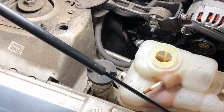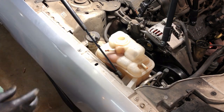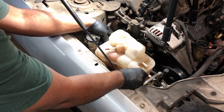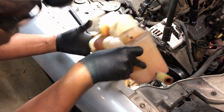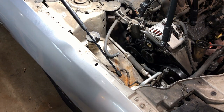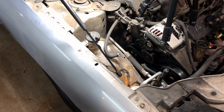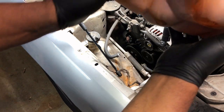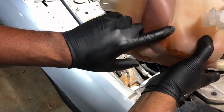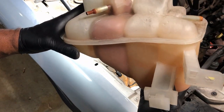We've got our washer off. We've got all our fasteners removed. Now I think we can simply pull up on this coolant reservoir. We've got everything loosened — our hoses off, our fasteners off — so let's pull up on this reservoir and get it out of here. Here's our reservoir, it's out. I'm looking it over to see any cracks and leaks, and I think that's our problem right there — I think that's the crack that's causing us some issues.